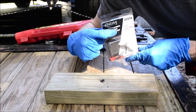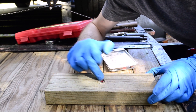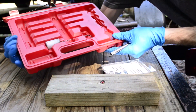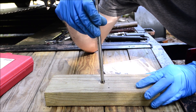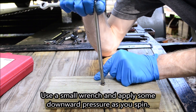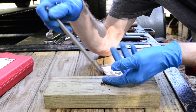To extract the electrode shield, first get one of the red rubber stoppers from the little kit and put it into the empty electrode shield — that stops any metal shavings from falling into the engine. Then grab the tap from the big kit and tap threads into the electrode shield. Slowly spin it in. Don't force it if it gets jammed — spin it back out, blow off the tap of any metal shavings, and go in again. Be really careful and slow — you do not want to break this off in the electrode shield, or you'll have to remove the cylinder head.